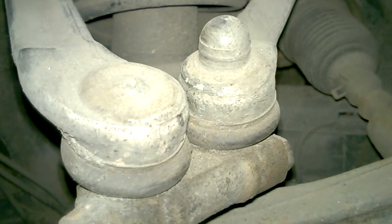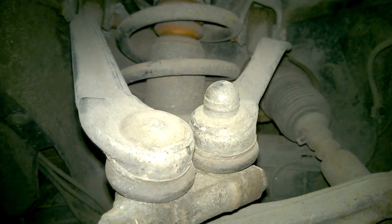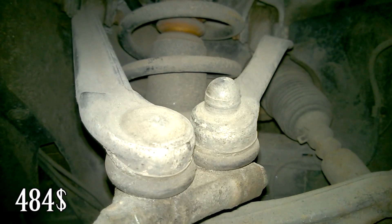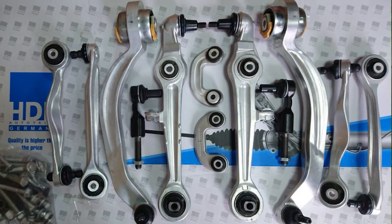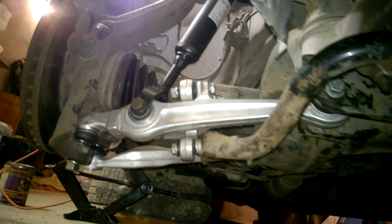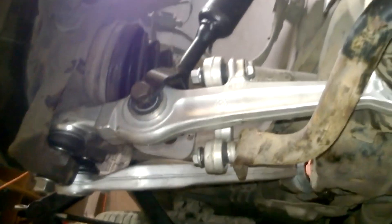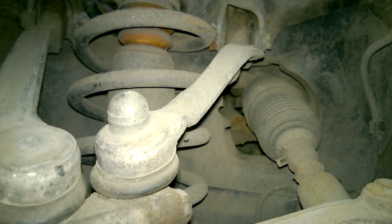Now let's calculate the entire front suspension for both wheels. This includes the lower control arm, lower guide control arm, the two upper control arms, plus the stabilizer bar link and tie rod end. In total, the TRW control arms will cost approximately $484. So if you want to install a good suspension, you'll have to pay around $500 just for the parts. Replacing only one control arm doesn't make sense because if one fails, it affects the others — that's why control arm sets are sold. It's cheaper and easier to maintain the suspension.